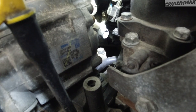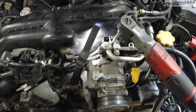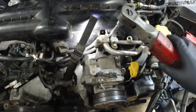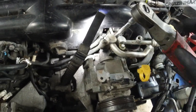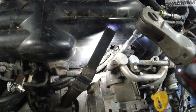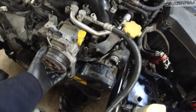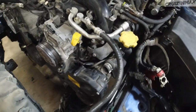With the air pump out, we have a better look at the bolt behind the bracket — the vertical one right in the dead center of the frame. That's the bolt you need to remove if you want to pull the compressor with the bracket. The difficulty of that rear bolt for the compressor bracket is that on the '04 to '07s the intake is also in the way. On this one the intake is a bit slimmer, so with an extended swivel extension you can reach it — it's a 14mm. The compressor is now free along with the bracket, which is a plus.